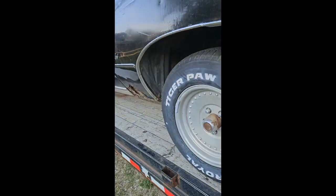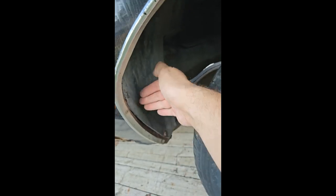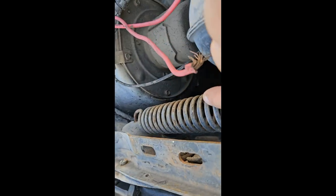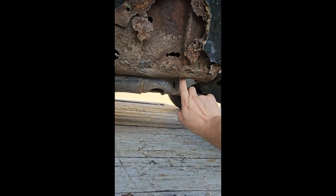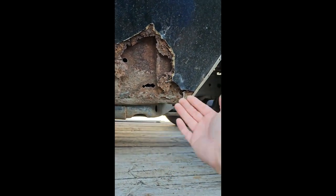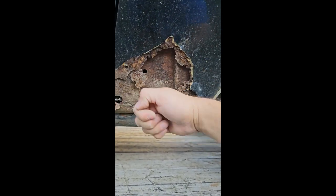The next one is a little harder. You're going to have to end up removing your wheel well tub, probably even up to here, so you can stick your hand back here. Not necessarily have to take the wheel well lip off, but you will have to loosen up the top of your fender. There's another bolt down here that you'll have to get to right on the firewall, and that'll just loosen it up. Once you're done with that, you can unbolt it here on the bottom of the fender — you'll have bolts on the backside, so you can kind of open this up or stick your hand through from the back.